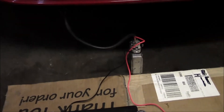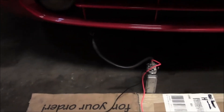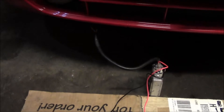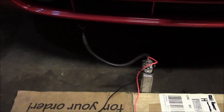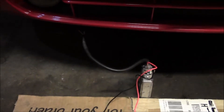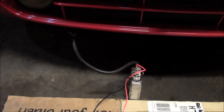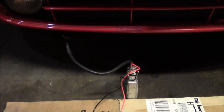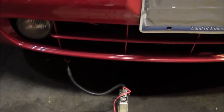That side works too — it's been a little finicky but it fired eventually. So right now we can deduce that both of the bulbs are good. The next step is to plug both lights back into their respective ballasts, and then jump the ballasts that are actually on the car. We know the bulbs are good, so there's got to be something going wrong with either the ballast, or maybe both will work and it's just a wiring situation — bad relay or the switch has gone bad.